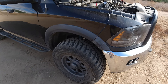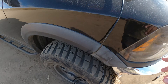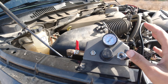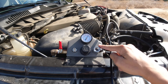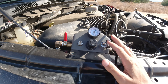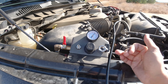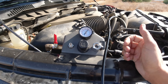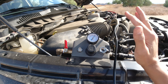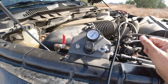The most important part of the whole system is the air controller right here. Once you have all of your lines hooked up properly and connected to your tires, you've got a pressure gauge on here that will tell you what your tire pressures are at. It makes it super simple to air down — just flip this valve to reduce air in your tires. Whenever you're done airing down, flip the valve closed and you'll see how much pressure you've got. It's helpful because you can open it up, let some air out, close it, and check your air pressure. Once you have a good idea of this, do it a couple of times and figure out exactly how long it takes to air down, set a timer, or just close it every once in a while and double check.